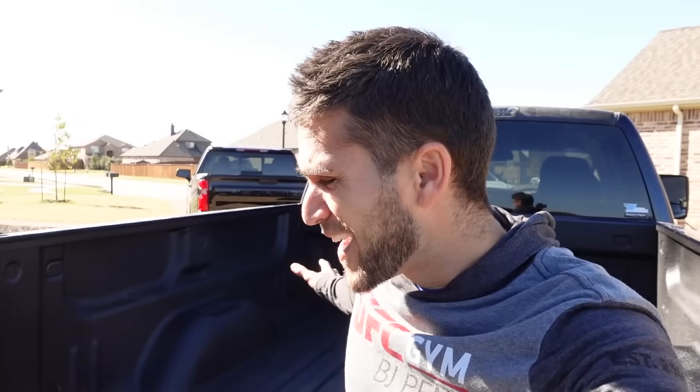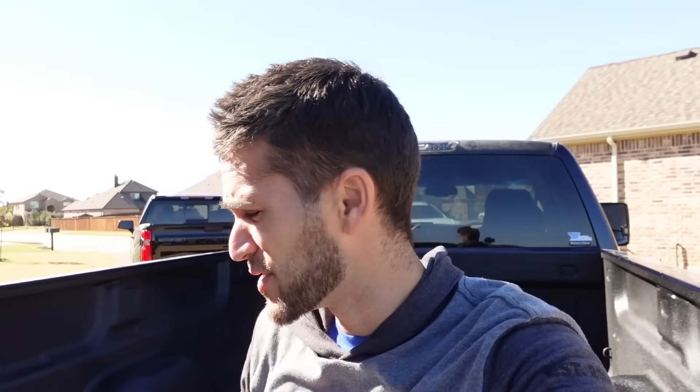This was a relatively easy install. It was a little bit messy - I do need to clean my garage up a little bit afterward. But it took half a day's work - a couple hours sanding and prepping it, getting degreaser, cleaning off the surface, and then essentially getting the gun and spraying it. Spraying it was the easiest part of the entire project. You do need a compressor, you do need an air regulator, and obviously the hose and attachments, but the kit comes with the gun, the hardener, and the material. It's up to you whether you want to do it outside - you can decrease the amount of dust being sprayed around. I did it inside to try to control it, and it's been incredibly windy the last couple days, so that was kind of a necessity.